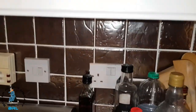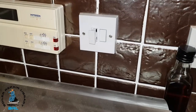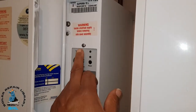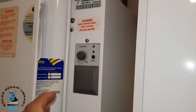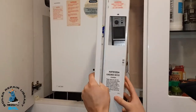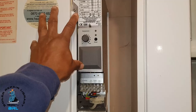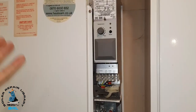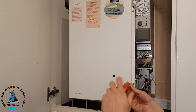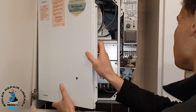What we're going to do is turn the power off here and take the fuse out. So that's out. Now we're going to remove this front panel here. Just undo that through there and that'll slide off. Then undo this screw there and that one there, and then this will come towards you like a hinge and it will come off. Just push up a bit.